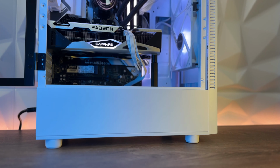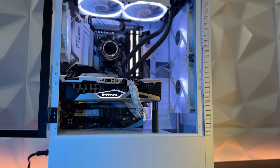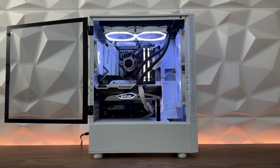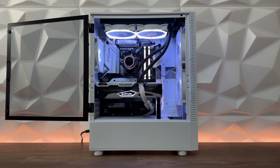You can place ITX, micro ITX and ATX motherboards inside. You have a possibility, if you go with 120mm fans, you can place 2 on the power supply shroud, 3 on front, 2 at the top and 1 at the rear. If you go with 140, you can go with 2 on front and 2 on top. The rest is still 120.